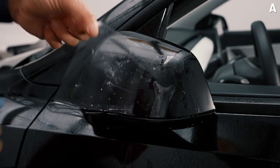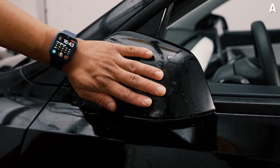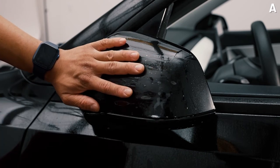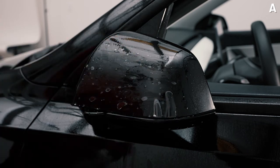For this section, make sure you have enough slip solution underneath and on top of the PPF. What we're doing is stretching slightly across the mirror — the indicator is getting rid of what we call wrinkles. As soon as you don't have any wrinkles, that's how you know you have enough stretch.